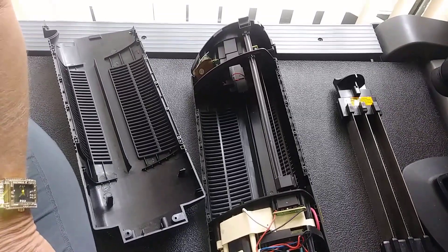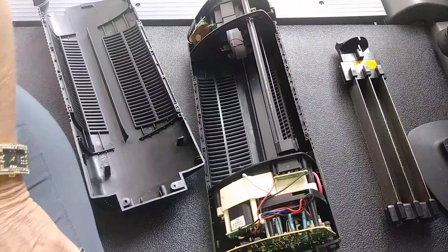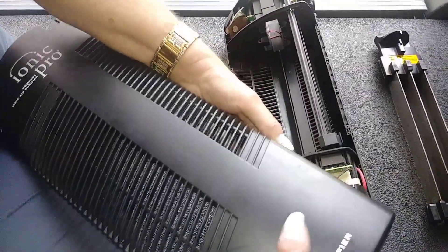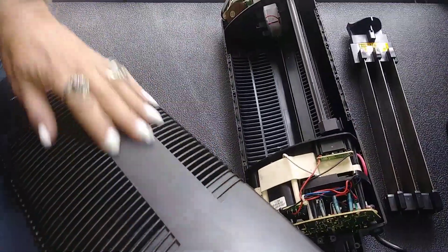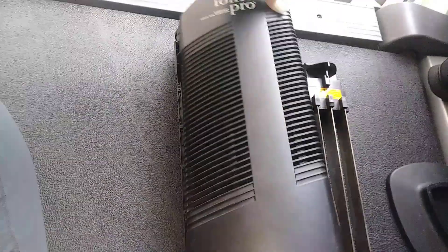That's how you open and service them — at least that's what I do before you throw it away. They really get dirty through the year, and when these get clogged it's not breathing and not doing what it's supposed to do. The ionizing works by electrocuting and grabbing particles onto this collector, and if it's all clogged up with pet hair, dirt, and dust it can't work properly. I take mine apart about once a year and it works pretty well.